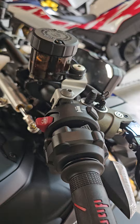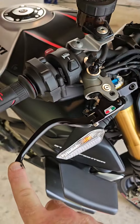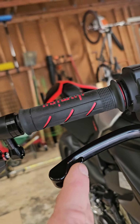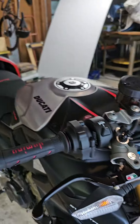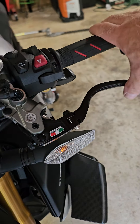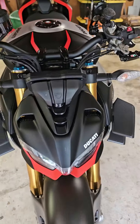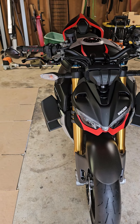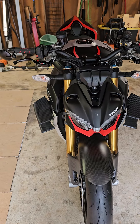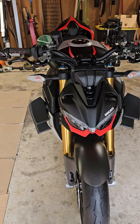I don't know what has happened there. I've never really done anything with these brakes other than pulling the calipers on and off to take the wheel out. My fluid level looks really good. I think this must have a little bit of air in it from the factory. These are not factory levers either — these are the TWMs from Moto Million. They're a beautiful billet lever with these cutouts for drag reduction. The adjustability on these is why I bought them, and they feel really nice. The clutch feels great — it has a hydraulic clutch. But I need to bleed that front brake, and I'm going to order an oil change kit from AMS Ducati along with the factory brake fluid.